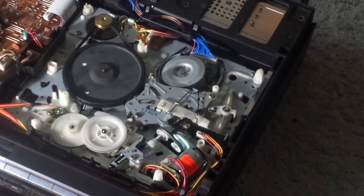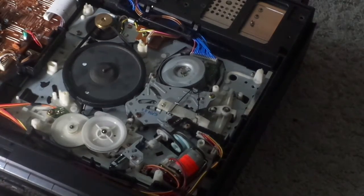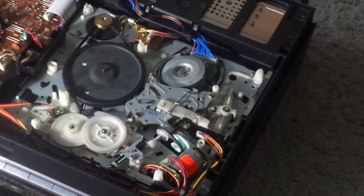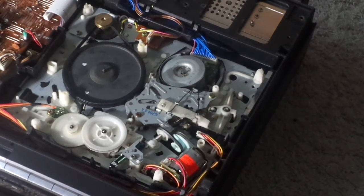I'm going to throw this one out. And I have a replacement belt right here. Now, if you don't have a belt at home, if you don't have a VCR belt and you want to repair it — if you have an old VCR, you have to take the bottom cover off, which is just unscrewing them with a screwdriver. There are just a few screws. So if you don't have a belt at home, use a rubber band — a certain size rubber band. That mostly works too.